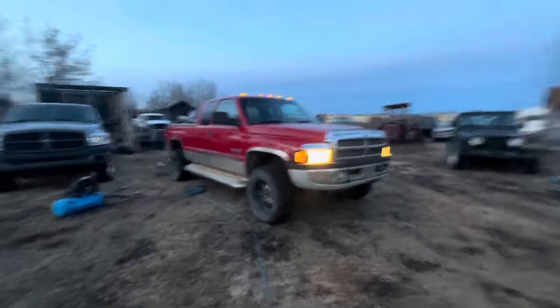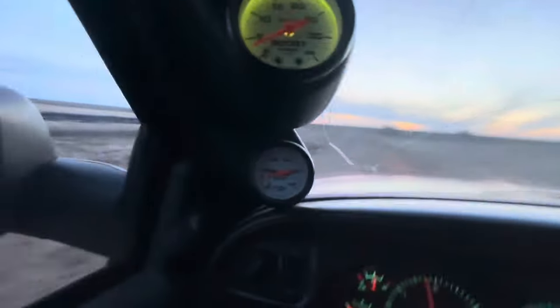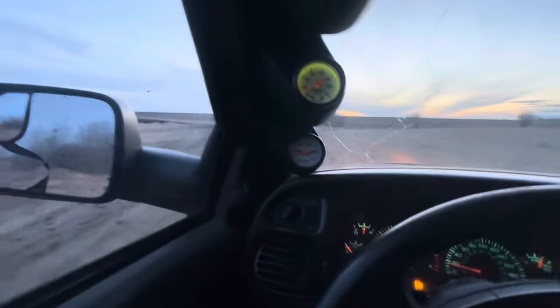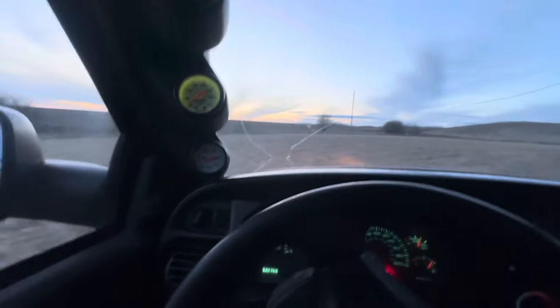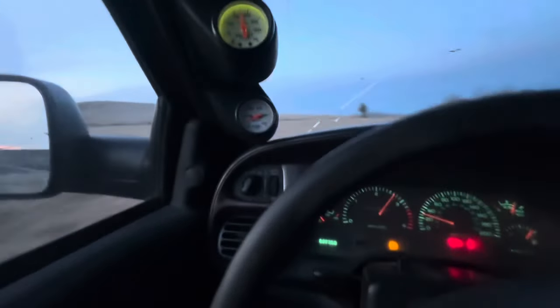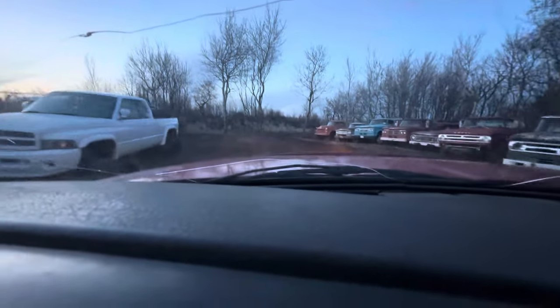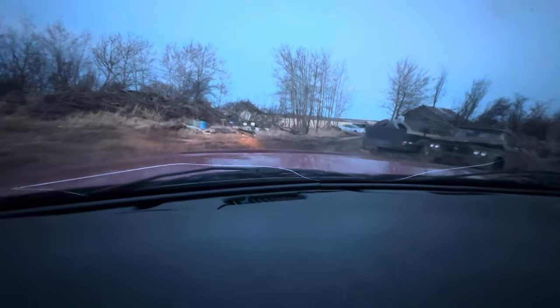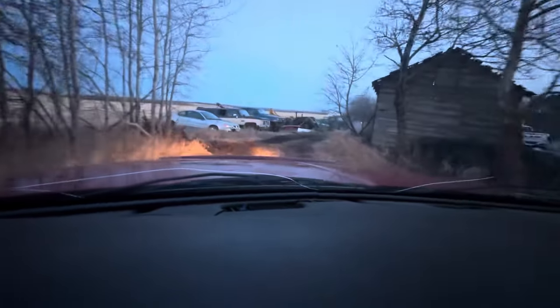Oh, yeah! I miss this truck. Oh, it's been a while, my old friend. I gotta just make sure she's still making fuel pressure. Don't worry about all the junk in the box. I don't care. The fuel pump is fine. The sock inside it was so stuck that I just ended up ripping the sock off, because that pump has two filters on it anyway. So what do you need that for?